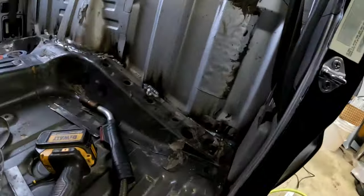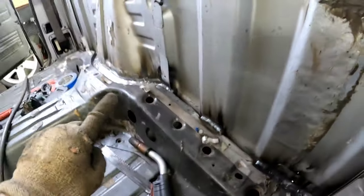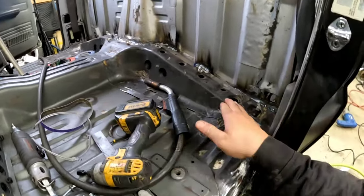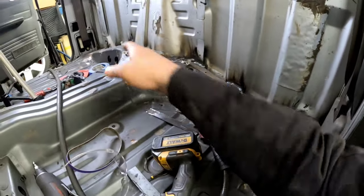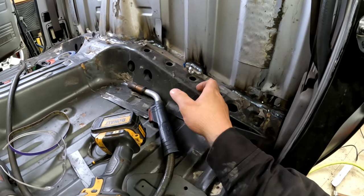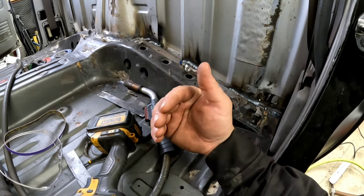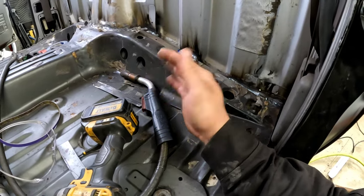That felt like it took forever, but it's cool. Got corner welded, hole center welded, and the same thing with the corner over there. So that's like 3/4 of the cab wall. Only thing I need to do is on the low spots here, here, here, and there, figure out how to fill that gap. I might be able to massage it inwards with some beading. Just depends on if I can make it look good. I might be able to pie cut it, fold it in, weld it up. Not sure where I want to go with that.